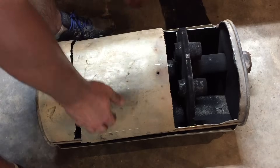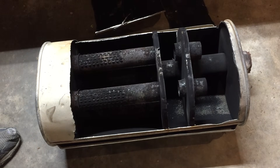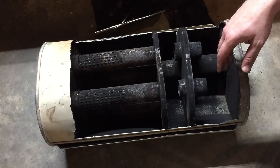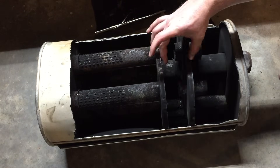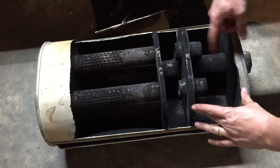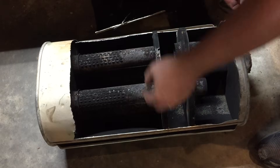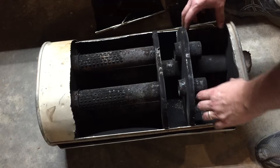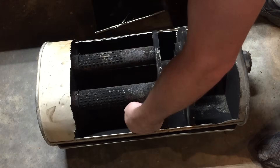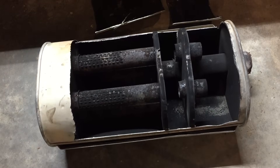Here's the reveal. That looks virtually identical to the way the Silverado was built. The dual pipes are the inlet to the muffler — there's no Y-pipe on the 99 GMC Yukon. Exhaust noise goes into this little narrow chamber here. I believe that's what takes care of the low-end noise, like the low rumble at idle. You step on the gas, that fills up, and it goes into this bigger chamber — you've got some destructive interference with the sound waves here. Once this cavity fills and goes into here, there's no exit other than these two pipes. So once all that chamber fills up, it goes into this lower tube into a very small cavity, the exhaust comes down, and that goes to the tailpipe. Pretty interesting.